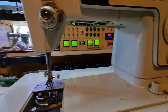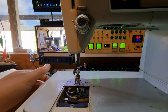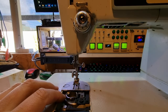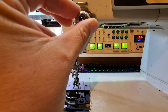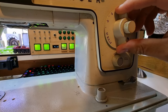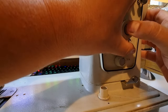I'm going to grab the wheel at the back here and give things a general turn to see if stuff generally operates as it should. I'm watching the mechanism move backwards and forwards and I'm not seeing the bobbin feeder come around, which is interesting. The tensioner is all intact and looks pretty good. We should be able to unlock this — this is one of the older styles where you have to push that in to rotate it.